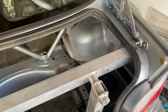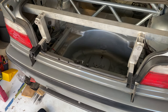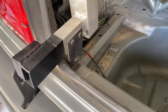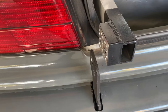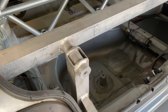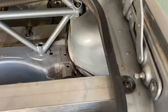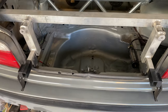The subframe is all 6061 aluminum square tubing. I machined the two cylindrical posts that stick out on top on my lathe — I put a step on them so each one went in a certain amount and hit the step so they couldn't be welded incorrectly. I don't do welding myself, so I took it up to Brett Coho here in Phoenix — he does a great job. You can see the speed holes I drilled in the square tubing at the bottom just to save some weight. The posts are attached with carbon fiber plates, and Brett welded on some L-shaped brackets at the bottom of my trunk area for support. The square tubing at the top is bolted to the trunk jam area.